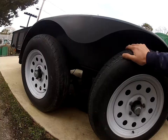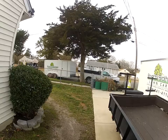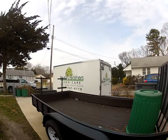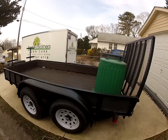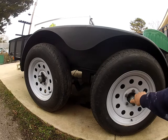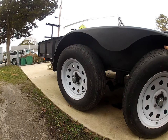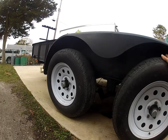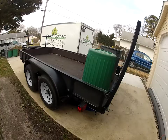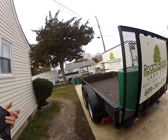It has electric brakes, which is great. With our Ram trucks you can't even feel the trailer behind you. At most, if it's very dry and we don't have rain, I'll put about five or six scoops of mulch on here, but usually we just run four to five — six scoops drags a little. These don't have easy grease zerks, so you have to take the tires off and grease the bearings. We do that once a month with the drive time it sees. In the spring it's on the road five to six days a week, and in the summer usually three to four days.